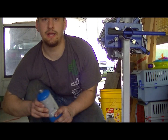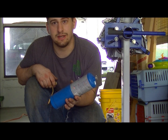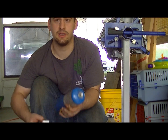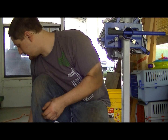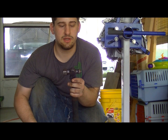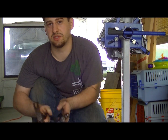The tools you're going to want: a torch — though I didn't even use it on these ones. I'm doing this on a 1989 Honda Civic. It had never had these bolts touched and I was able to remove them without heat. You're also going to want two hammers: one ball peen hammer and one standard hammer. What you do is use the ball end and work around the bolt — smacking there causes a vibration and loosens the rust.